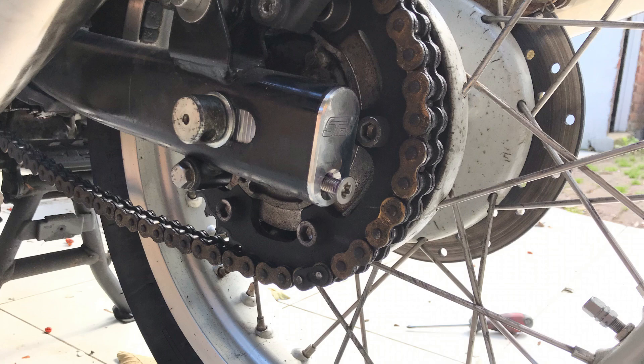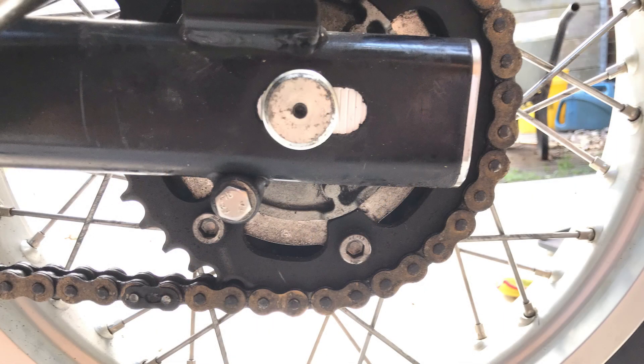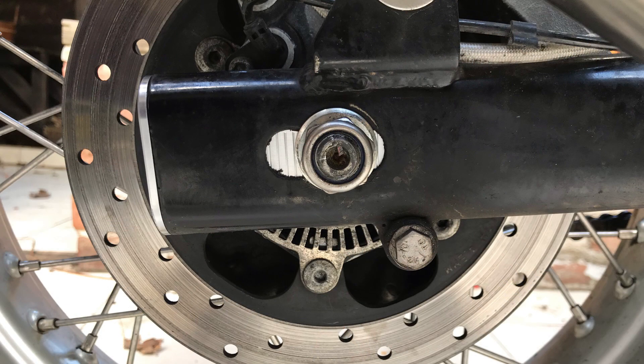These next shots show the wheel now tensioned - I've tightened up the axle. You can count the number of grooves from the new washer backwards: one, two, three, four and a bit lines from the edge of the washer to the end of that little window - four and a bit. This is the other side: one, two, three, four and a bit from the new washer. You want to make sure that your wheel is aligned correctly, same as with any chain tensioner.